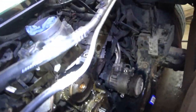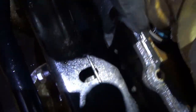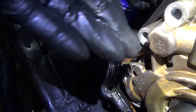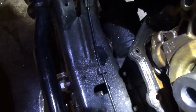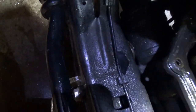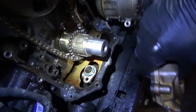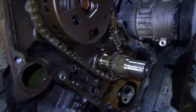The oil pump is a little bit of a struggle just because of that pickup tube. Even though the bolt is out, the pickup tube and the lip — you see the O-ring right there — is still holding the pump from the bottom. So basically just pry that down, pivot the oil pump this way, and now it should wiggle off. There we go — there is our prize.